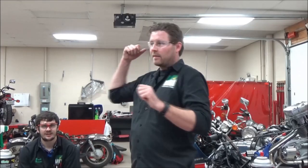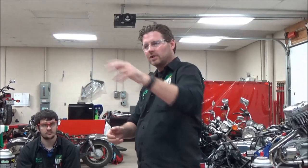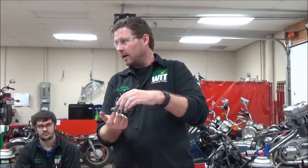If this doesn't work, my customer is going to grab a handful of gas, the bike's going to stumble, and something's going to be wrong. At any time I give it a handful, it dumps that diaphragm and shoots it through. Did you also notice it'll only shoot so much fuel with each pump? So when you let the throttle off, that chamber refills with however many cc's is the size of this accelerator pump.